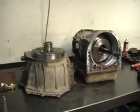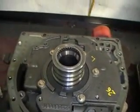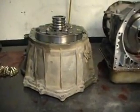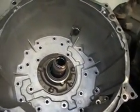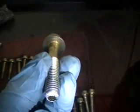There it is — just look at the size of that input drum right there. That is the pump. Now we need to remove the 10-millimeter bolts and the rest of the bolts from the front of the bell housing so we can separate the pump from the bell housing. These are the bolts that were attached and holding the pump itself — see how they've got a little rubber O-ring on them. The ones that hold the bell housing don't have anything on them — that's the difference between the two.